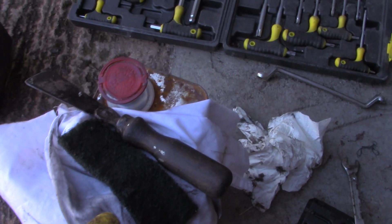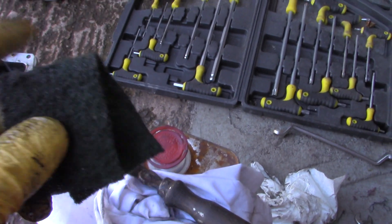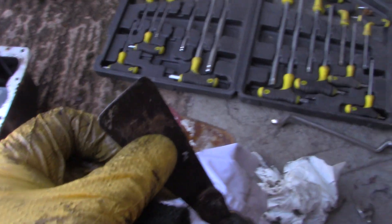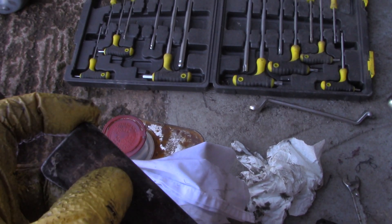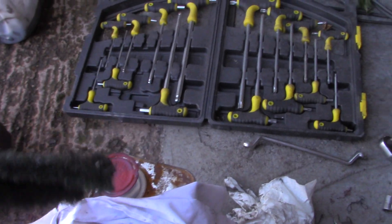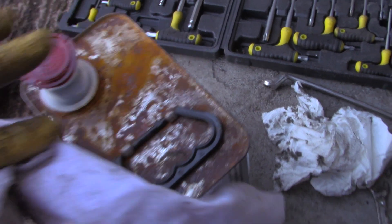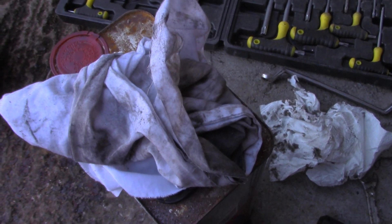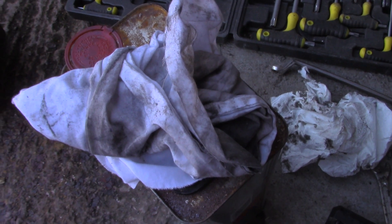What I have used for cleaning on the side of the block is a Scotch-Brite pad — you get the same texture in some of the cheap household sponges. First of all, take off the old silicone sealer using an old paint scraper with the edges worn off the bit — that stops it from scratching aluminium or plastic. Then use the Scotch-Brite and some pre-wipe degreaser. Paint thinners will do — any solvent — give it a good clean. The engine block needs to be immaculately clean.